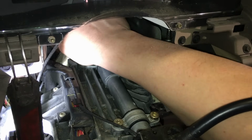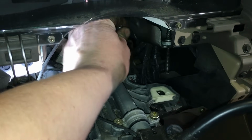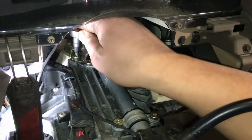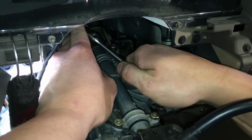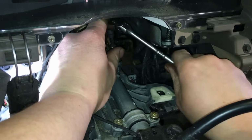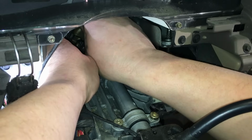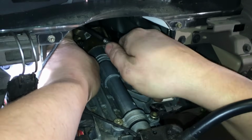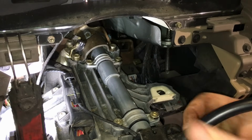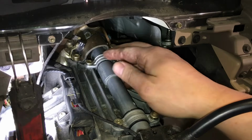You can see, the steering column, you take it apart and try to rebuild one of these, it looks a little complicated, but you just take one step at a time. Hopefully watch a good instructional video like this one that walks you through it step by step, and you can change these components out, no problem. Nice and tight. Don't forget that 3rd bolt back here, if you have it. All right, and there it is. I'm picking up in this whole column now. There's no slop, so it's good to go now.